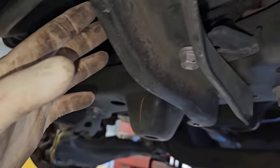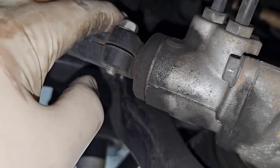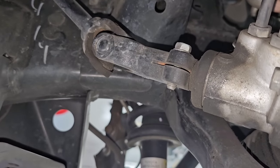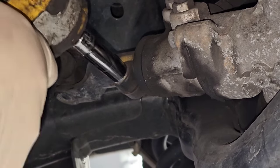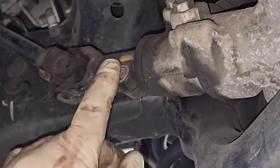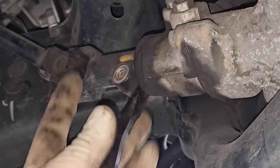So now you can get to the power steering lines right here. I might have taken these cross braces out — it might make my life a little bit easier with these out of the way, so I might just drop those out. And then you've got the steering shaft here — you're going to disconnect that. I do have the battery disconnected. That's step one when you're doing something like this. Just be mindful not to spin the steering shaft, because the key is in an unlocked position — I want them to have the ability to turn the wheels just in case. So this way I can take that pinch bolt out. Let's knock that pinch bolt out. You can see it wasn't super tight, just enough to keep that thing locked in place. Now we're probably going to get a pry bar on there and it should separate relatively easy, I'm hoping.